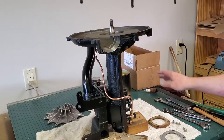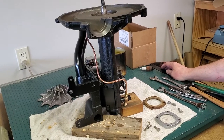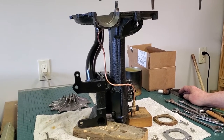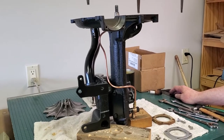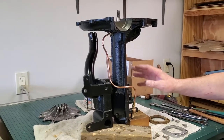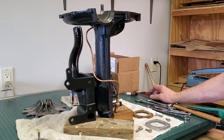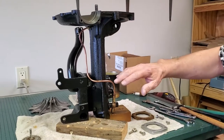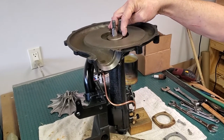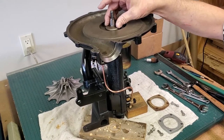This supercharger is now made from two superchargers. The first one the owner sent from the Midwest turned out to be frozen — not because of normal causes, but because it had been run without oil, making it nearly impossible to take apart. When we got it apart we found the bearings had been melted in the bottom portion. We had to use components from the second supercharger he sent. We're still missing our top seal and we're now having CNC-made top seals produced — I'm having four made because I've got four superchargers to work on.